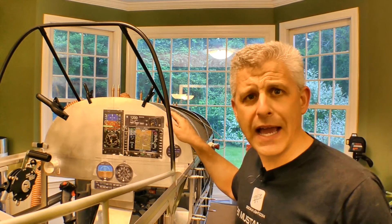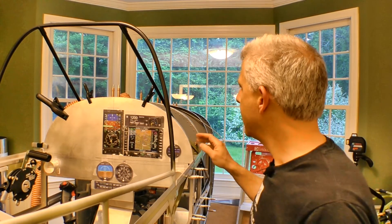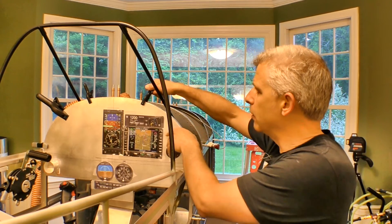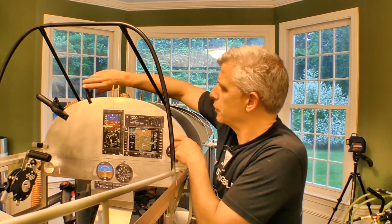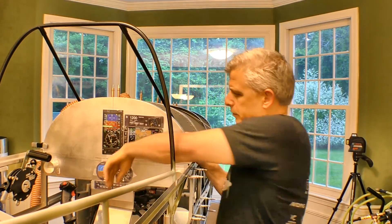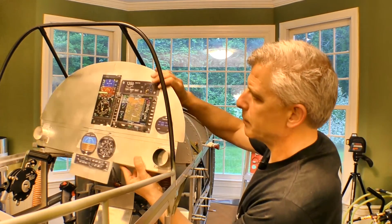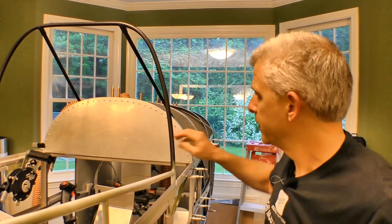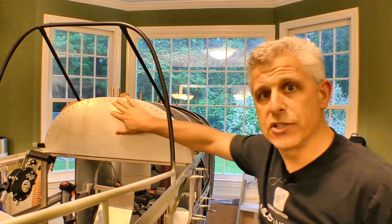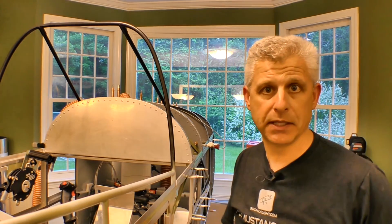When it comes to the actual construction of the panel, we have to level this part here and make sure the panel is straight up and down. The panel itself has a supporting structure behind it, which is the actual upper bulkhead. I'm going to take this off to show you what that looks like. So this part is the actual panel, and behind the panel is this supporting bulkhead. Normally in the instructions, you cut this out so it's just a support along the perimeter, and then the panel can be screwed in and removed along with the avionics for easy maintainability down the road.